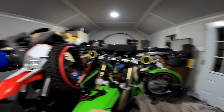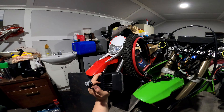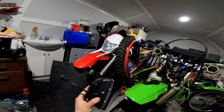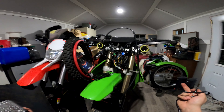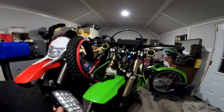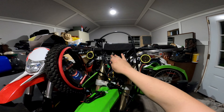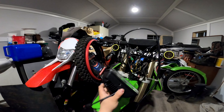I've already wired that in — simple job taking the number plate off. I've also got a new four-by-six LED headlight with DOT SAE markings. The low beam is just dim and the high beam is just bright. I've drilled a hole in the bottom of it and I'm using the original dash mounting bracket, bent down a little bit with a screw threaded into the aluminum. I'm not sure how well that thin aluminum will hold, but we're going to try it out.